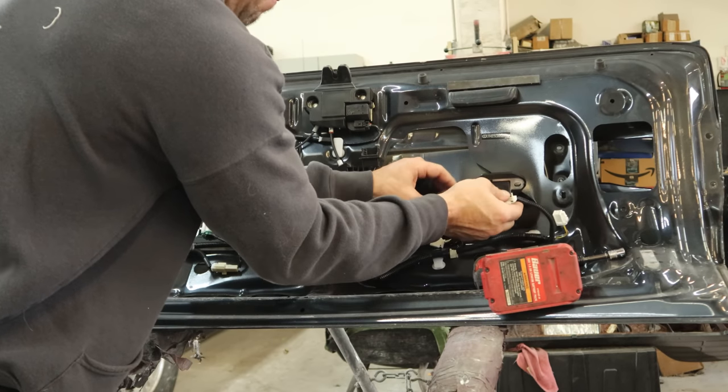We'll bolt in our hinges that are now all painted up along with all the rest of our stuff. We'll line them up with our old marks and put them down to manufacturer's specs. Now we're ready to put our deck lid on, which has magically changed colors. We'll set it in there, use our head to prop it up — we don't use it for much else — and tighten up the bolts. They're self-aligning so we don't have to worry about lining anything up. Now we're going to put our latch back in and put the lock in so that after we close the deck lid we have a way to get back in. Bolt that in, bolt in our latch, snap in our cables, close the cover, and close the deck lid — and hope we can get back in it.